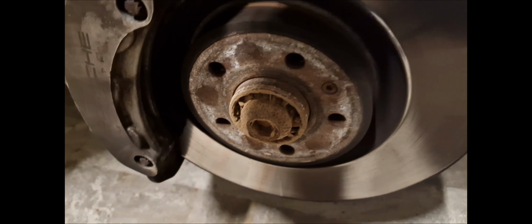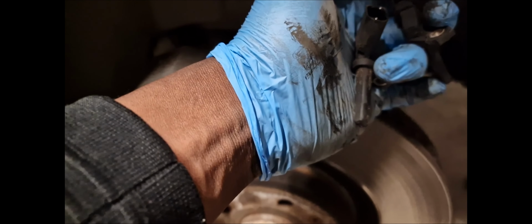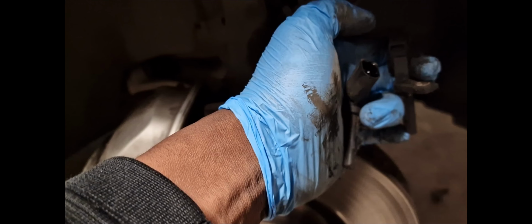He's not gonna be impressed, mate. Okay, let me just plug this sensor in. So I'll be taking this one out and putting this one in. Then we're gonna see if the fault swaps from left to right. That's ideally what I want to see. If not, we're gonna have to look at the wheel bearing. Actually, no, if it's not, it's not the wheel bearing, because yeah, this fault better swap, mate, otherwise it's gonna get a bit puzzling. Right, cool.